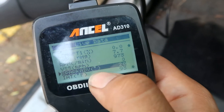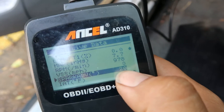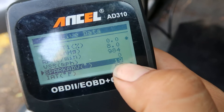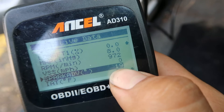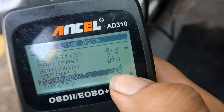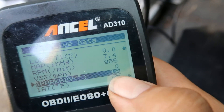What I really want to find out is what the timing is once it reaches operating temperature, because that's going to be the baseline I start off on my ignition map. It should be around 12 degrees if I'm not mistaken, because OBD1s are roughly 16 degrees — but I could be wrong. Let's let it warm up and see what it does.